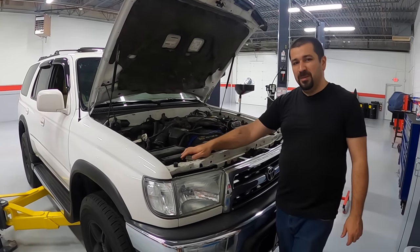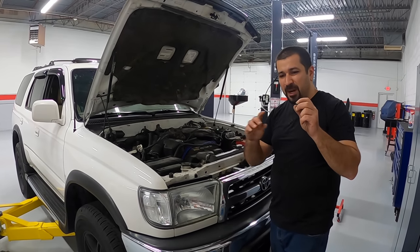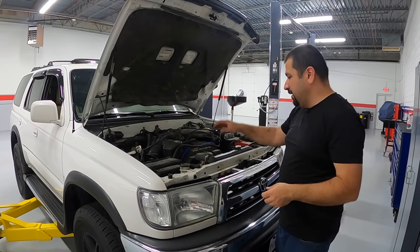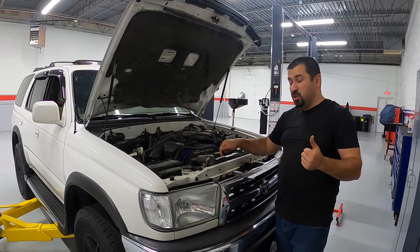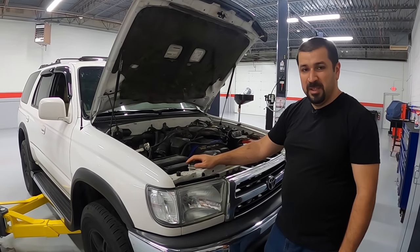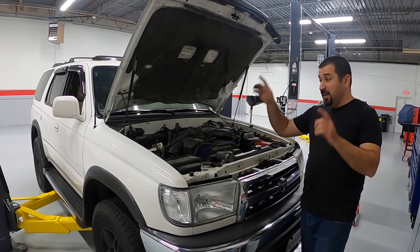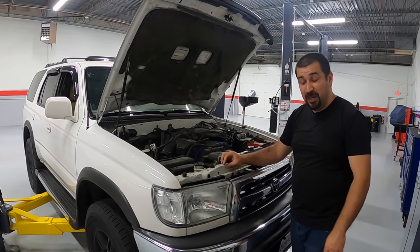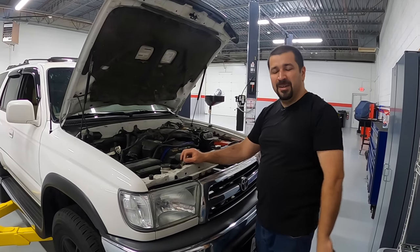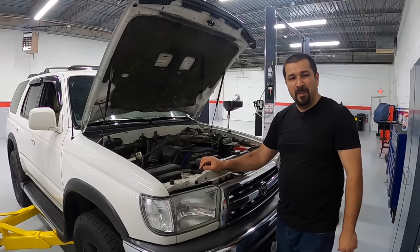If you don't have a rusty one, these are really good trucks. Just be careful of the snowball effect — an original radiator needs to go because it could destroy your transmission very quickly. When buying one, pull the transmission dipstick. If you see a hint of pink fluid, you're closing the hood and walking away. Of course, that's after you check the frame, which you can easily lean underneath and see. Let's take a quick peek inside this truck, which is really in good shape.